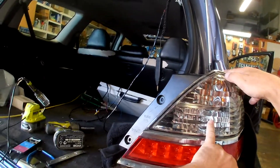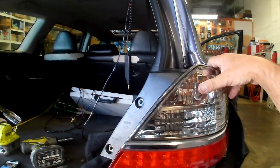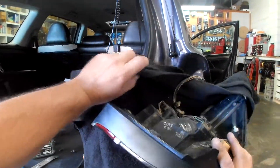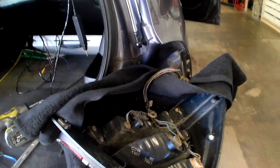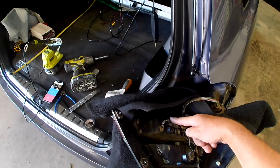This is the one I want to access, so I need to know when this light bulb comes on and send a wire to the front to tell the radio, the camera, or whatever it is I need, that that light is on. If you look at the back of it you'll see the same basic thing: indicator, reverse, brake, and tail.